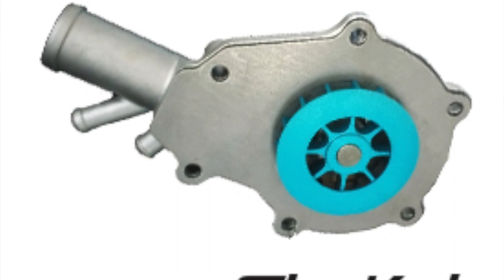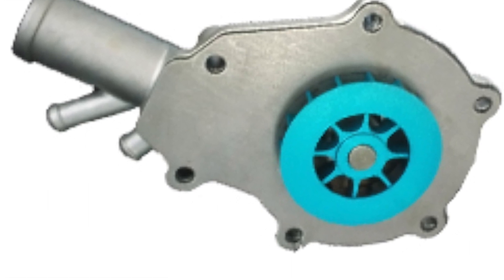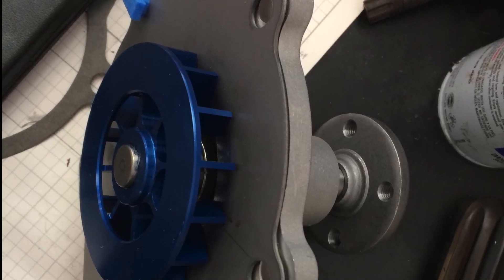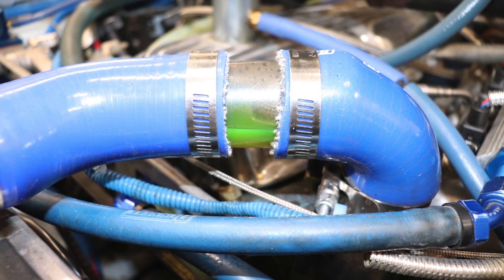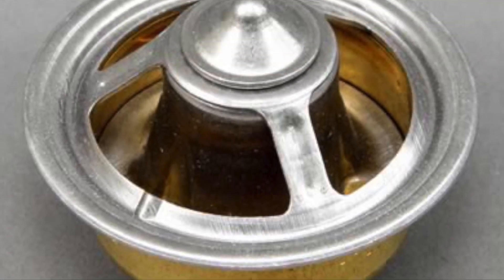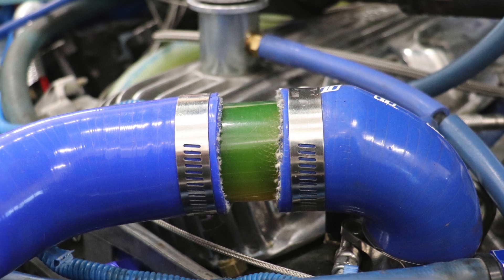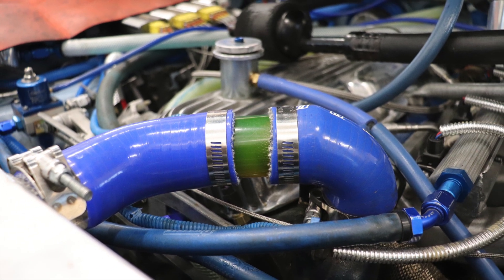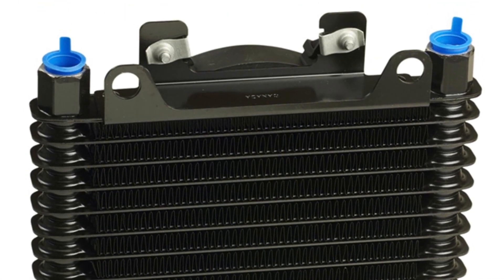Since the trip last summer, we've also upgraded to a high-flow water pump made by Flow Cooler. Some people think you don't necessarily want more flow because coolant needs to sit in the radiator longer, but if the water is sitting longer in the radiator it's also sitting longer in the block and warming up - so sometimes you do want more flow. On the trip I actually removed the thermostat entirely to eliminate one restriction, which worked great in the South but coming back through Oregon it was nearly snowing and the engine only reached about 140 degrees. Being fuel injection, it still ran great - the Haltech just adjusted for the lower temperature.